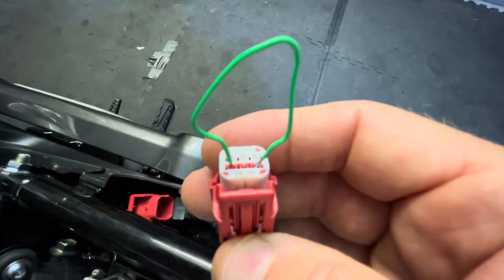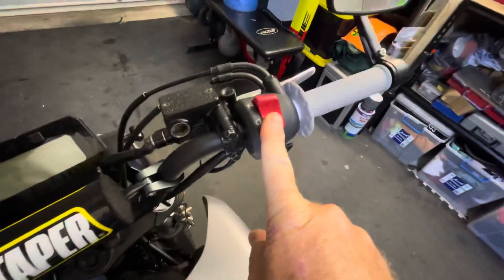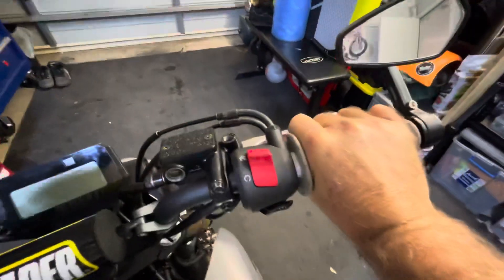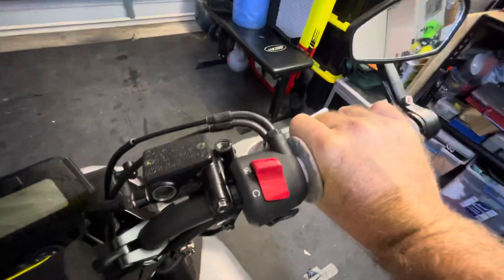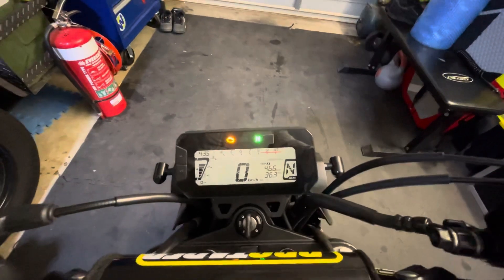Come to the dash of the bike, make sure your run switch is on, then open your throttle all the way up. This is how it knows to reset its throttle position sensor. You'll know if you've done it right because when you turn on the key, your engine management light will stay on and then start to flash rapidly.